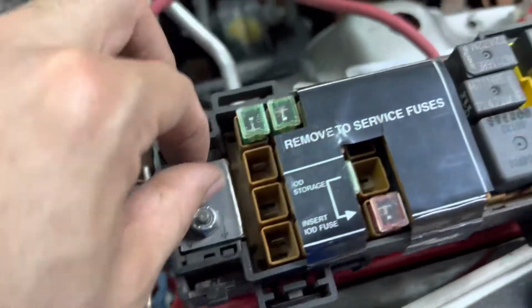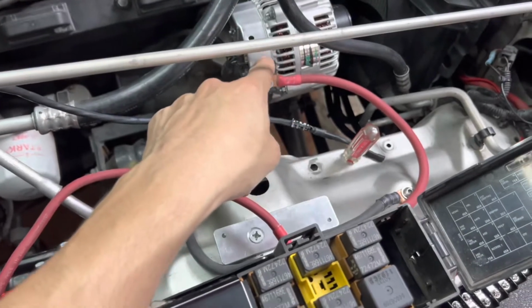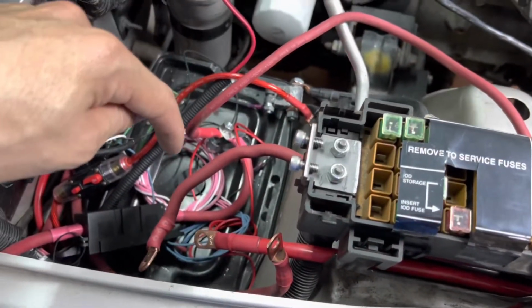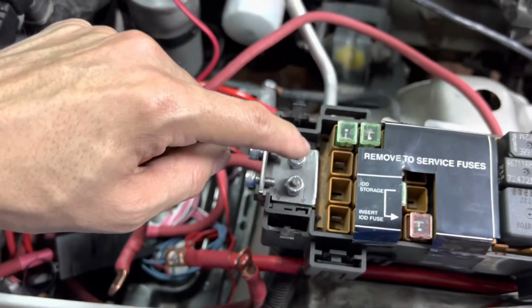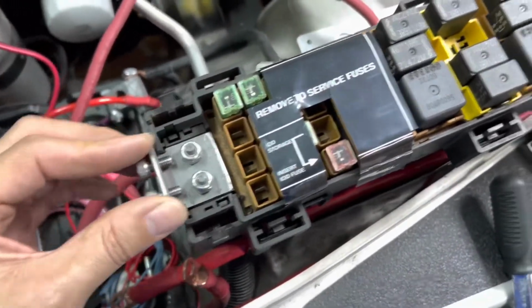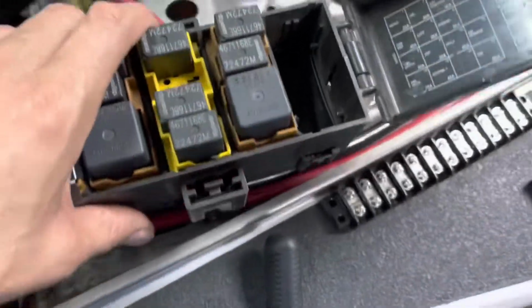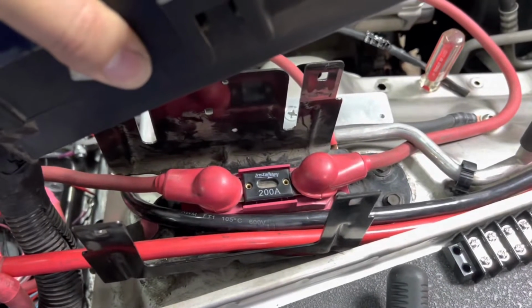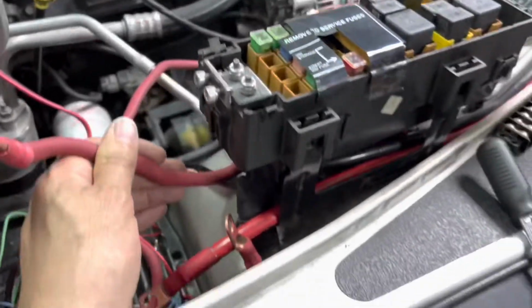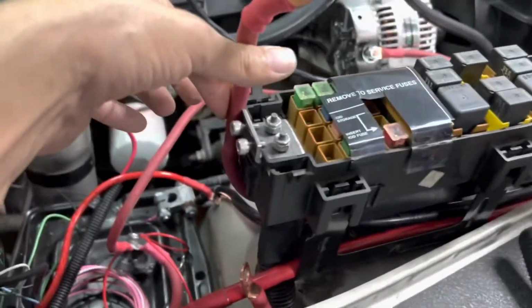And now, since I relocated the fuse from the starter, the fuse that runs from the alternator, it used to run from the alternator, loop around into the fuse here, and then come around and make this big 180 degree bend to bolt into this stud here. And the problem was I had to get my battery in and out, and it was becoming a problem. So now, instead of that, it comes off of the alternator, down underneath my AC line, and into my secret hiding spot underneath here, under the PVC box, and comes out on this end of the PVC box. I gotta cut this cable shorter, but now it'll cut 90 degrees straight up into that bolt right there.